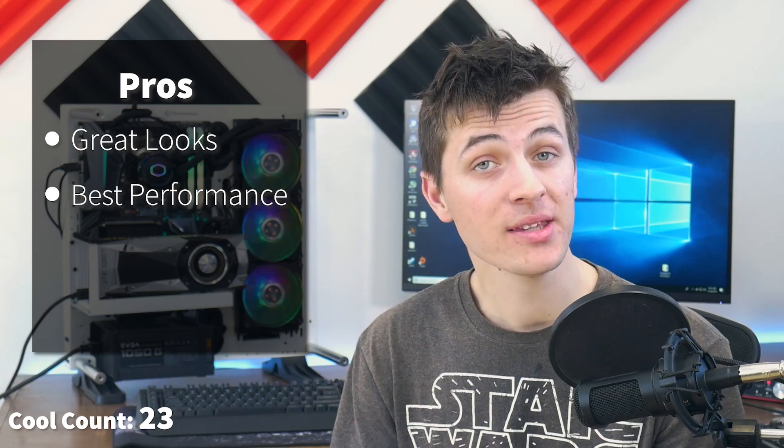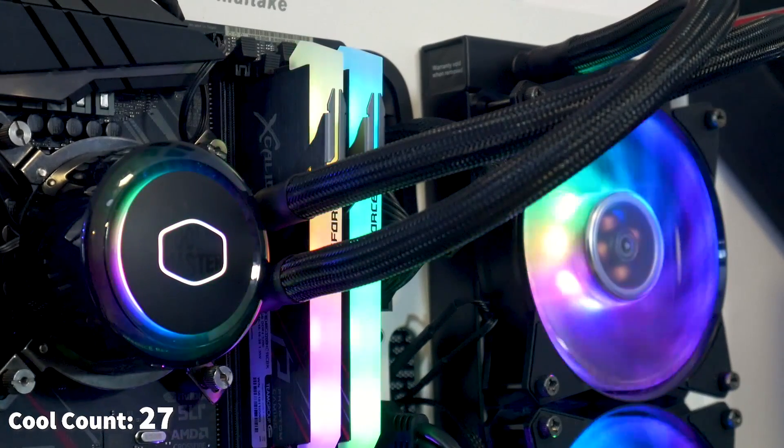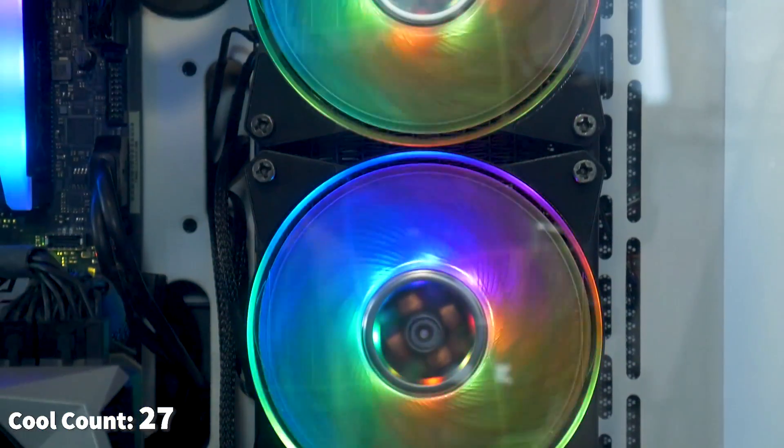The next pro is that it's extremely good at cooling, which is exactly what you want a CPU cooler to do. It gives you about the best cooling possible without going to a custom water-cooled loop. I have the Master Liquid 360 RGB cooling the i9-9900K — previously cooled by the Hyper 212 EVO RGB, which wasn't adequate. The 9900K was thermal throttling at around 100°C on stock settings. Once I switched to the 360 AIO, I was able to overclock to 5.2 GHz and still keep temps at 70–80°C, never hitting 90°C.